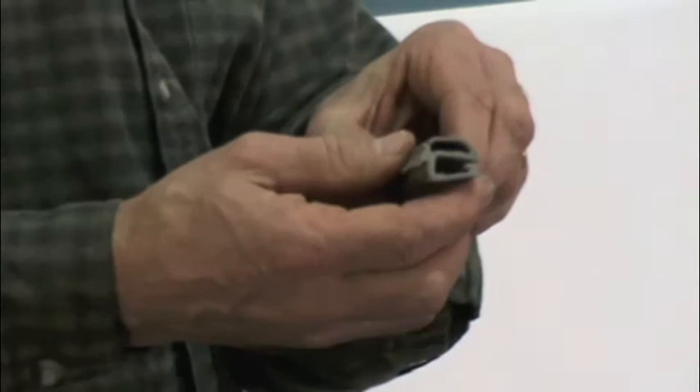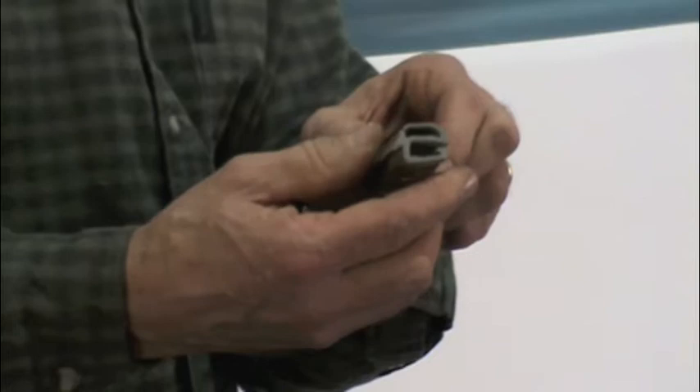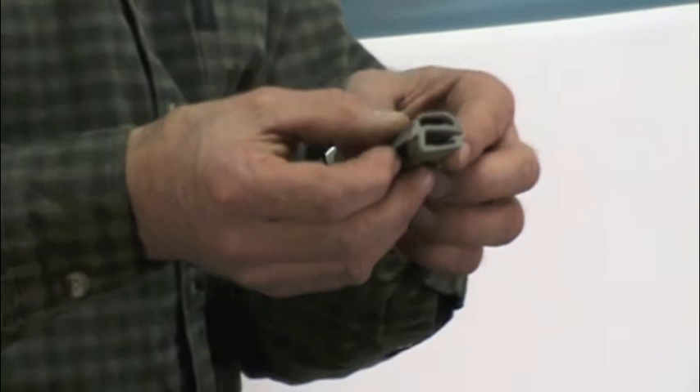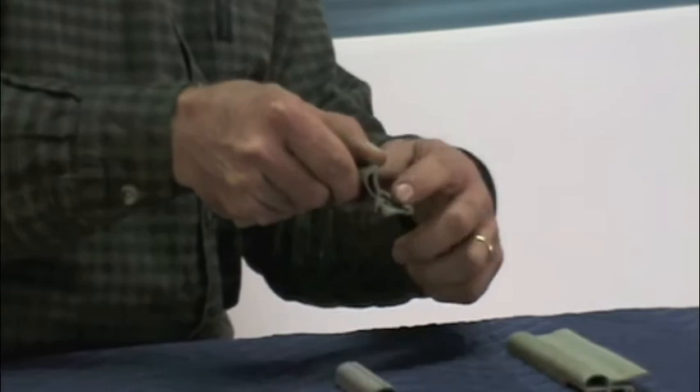This is a little different variation of the same shape gasket. This is from a Kelvinator made in the late 40s. You can see it's a little more complicated — it has little extended tails on the right and on the left, and it's a much wider gasket. Most of that is to cover up the mounting screws or the mounting brackets underneath that attach the gasket to the door. If you just lift that gasket back underneath, you'll be able to expose how it is mounted to the door.